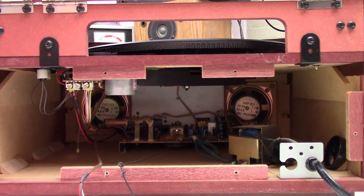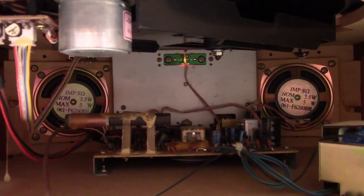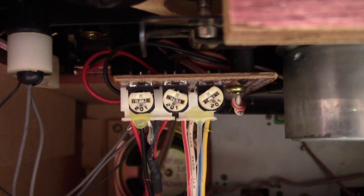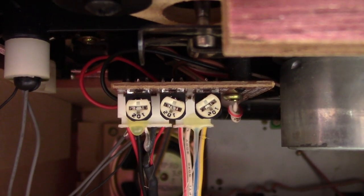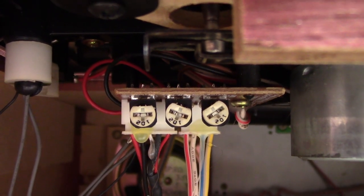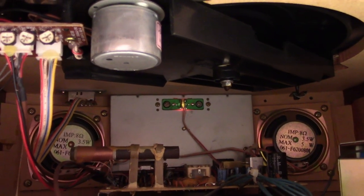Here is looking at the back side of this unit. I've got it open and I'm looking inside — what do I see? I've got three speed control pots, most likely 33, 45, and 78. Unfortunately, because of the LED lights, I don't have a 60 hertz reference to adjust this to, so I'm just going to have to do it by ear. But anyhow, there is the inside look of the unit.